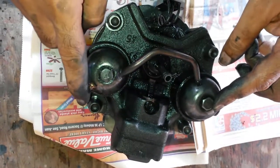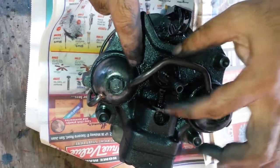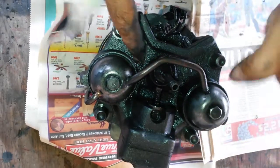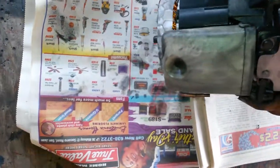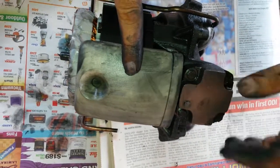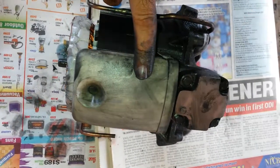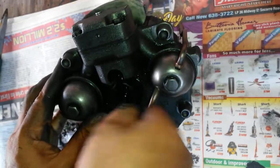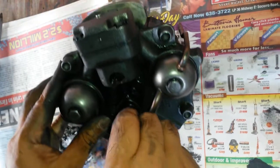Not sure why there are two of these or what they are — it looks like this is the discharge side, two ports of the pipe. There's an eccentric — something like a camshaft. So the motor shaft just was not going around, and therefore this is the suction side. It looks like they have a filter or something inside here, and then this would be the chamber with the compressor and the valves. I'll pop this out and open it. The cylinder is actually spinning very easily, so it shouldn't be a problem.